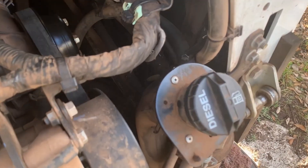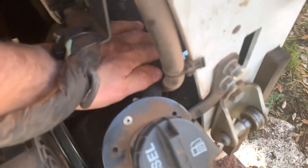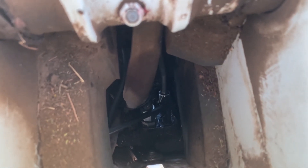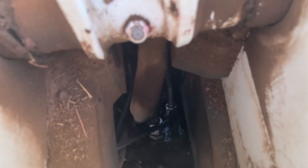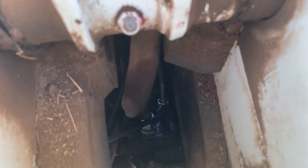I managed to figure out it appears to be a three-eighths Allen wrench fitting on there, so I got an Allen wrench wedged in there right now. I think if I took out this fuel filler neck area here and got this hose out of the way, I might be able to put a couple cranks on that and try to tighten it. That thing probably has an o-ring behind it, so it'd be good to take it out. I'm thinking I'll just try to put a crank on there and see if tightening it stops the leak, and if not, pull the whole thing out and see if there's an o-ring to replace.